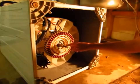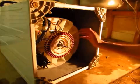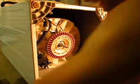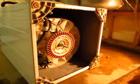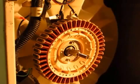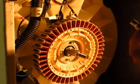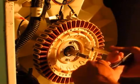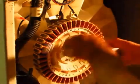So the next thing we have to do is there's 4 bolts which hold the stator in place, which need to be removed for the stator to come out, and the stator has to come out to get this position sensor off. So this is how I did that. I used a socket set and a 3/8 socket to remove this, and just loosened all the bolts.